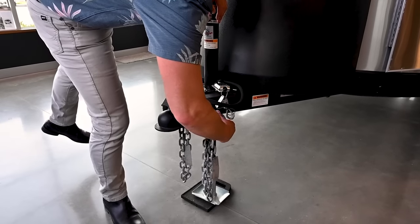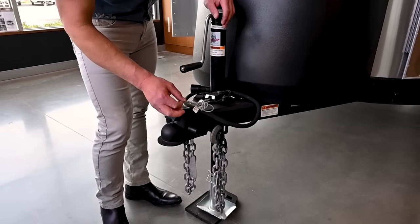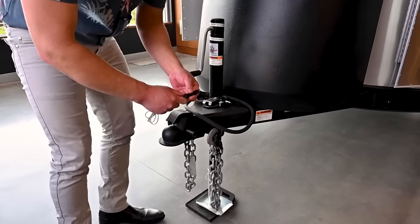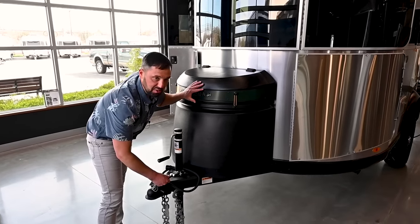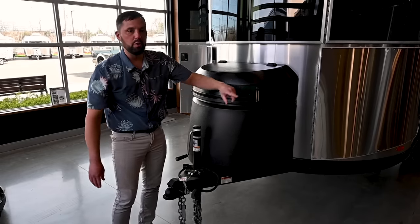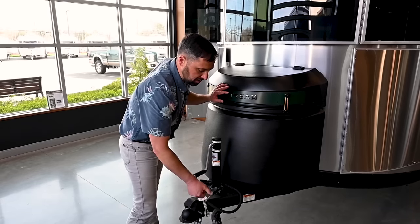There are safety chains which you attach firmly to your hitch receiver — make sure you crisscross them and take any slack out so they're not dragging on the ground. There's also a trailer breakaway cable which gets firmly attached to your tow vehicle. If the trailer detaches, this will pull out and lock up the trailer brakes. Don't use this as a parking brake — when pulled out you've got full voltage going to the brakes, which can burn out the magnets and in a few hours completely drain your battery system. Always make sure this is in and the cable's not frayed.